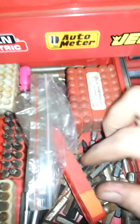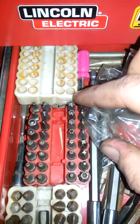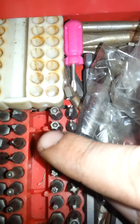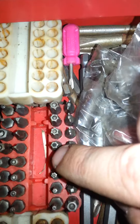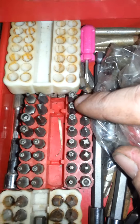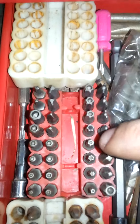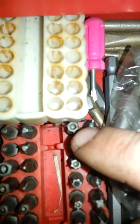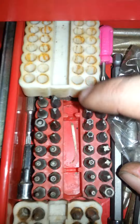All your good USA-made stickers - very important. The top drawer has all kinds of bits: bits for impacts, adapters for 3/8, 1/2 inch, and quarter inch - a couple of each. This wasn't a kit I bought, just all different kinds accumulated over the years. These are security bits from Harbor Freight. These torx bits have an indent in the middle - you need them for certain fasteners, like ignition components, coils, or ICMs. The downside is they're very soft and cheap - they'll strip right out on higher-torque fasteners, so be warned.